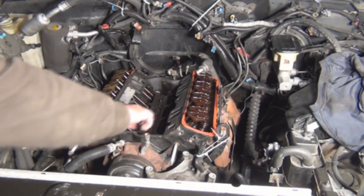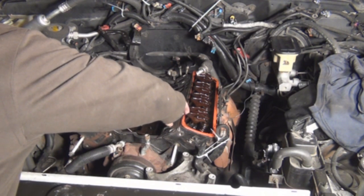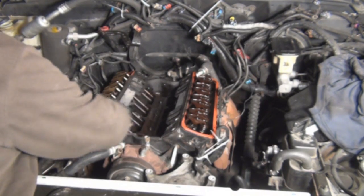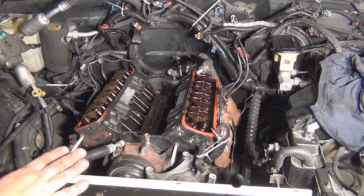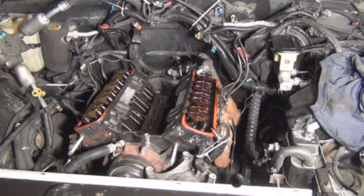Take these two tabs, line them up right here — one, two. Make sure you're keeping everything clean. It won't slide all over the place. Now, I should mention this is a 5.7 Vortec engine in a '98 Tahoe. For whatever reason everything needs to be thick — I think it's a warpage issue. It's not too bad of a warp where you can't fix it; you can just put thicker gaskets on it, which is what we're doing.